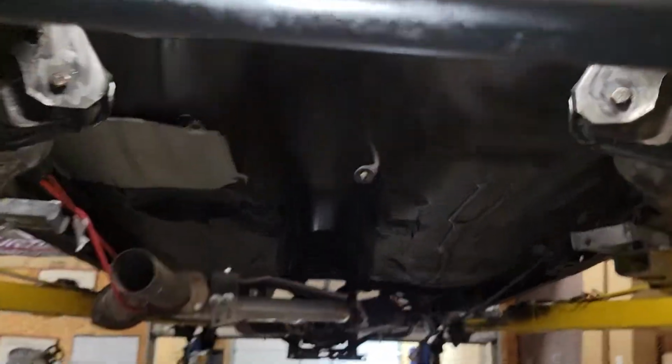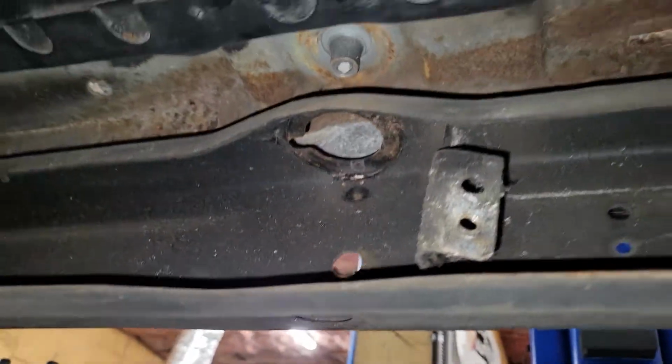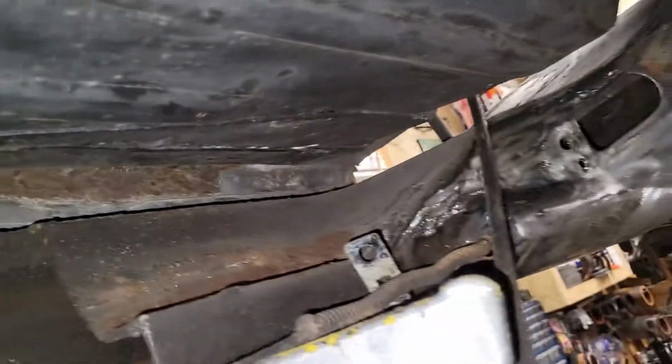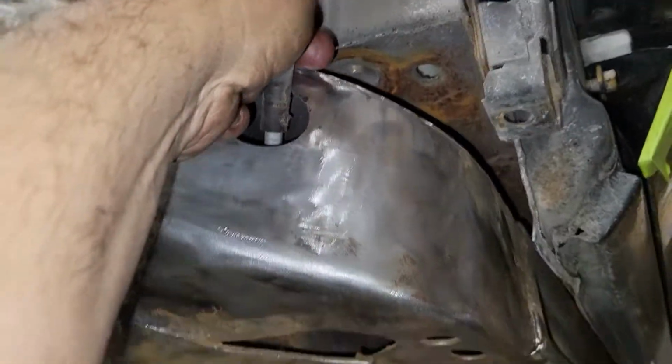And here we are underneath it. Very solid floor pans. A little bit of superficial rust, surface rust. Nothing crazy. Pans are fairly clean. I'm going to give them just a quick spray. We've already wiped them down weeks ago. There's my safety nets for my fingers. One thing I learned today, a little tip: release these three fingers. Give yourself some slack when you're doing body bushings.